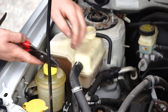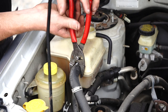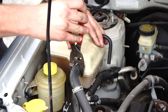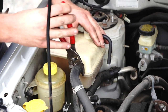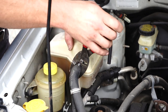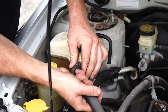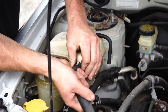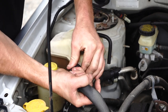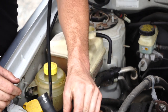Be gentle with this pipe. You want to fully adjust your pliers out, nice and gently, and just give it a bit of a rotate. You'll feel it actually unseize. The plastic and the rubber hosing moulds together over 10 or 15 years of use. Just pull it off nice and gently and put that pipe to the side.